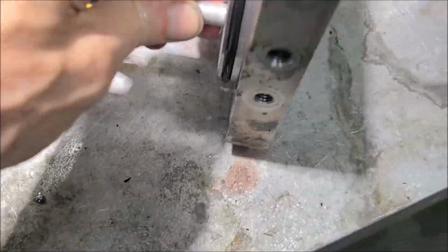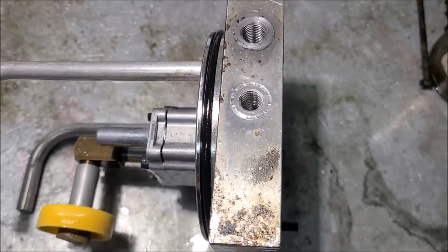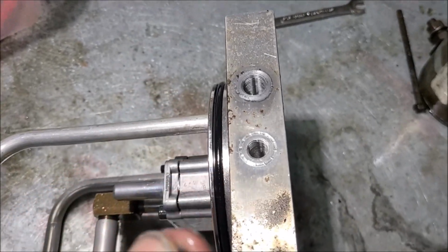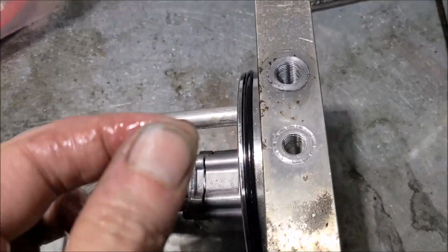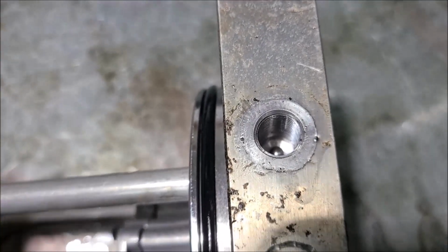I found this out because of one of my YouTube subscribers. He was troubleshooting his pump, and he found out the hard way. If you take this out, that ball is going to get gone. It's going to fall into the tank. I mean, it turned out his pump was worn out anyway. He had to replace the whole thing. But just to show you again, because normally that ball sits just like that.